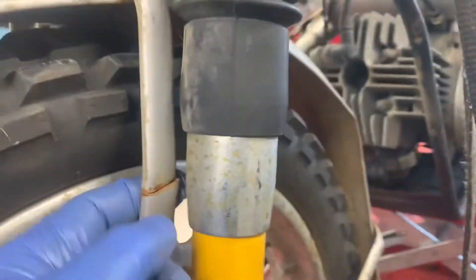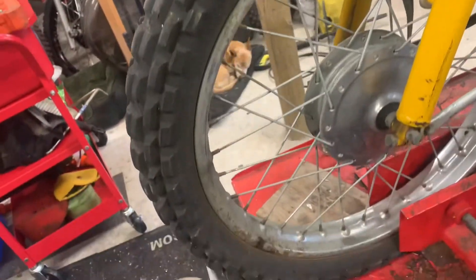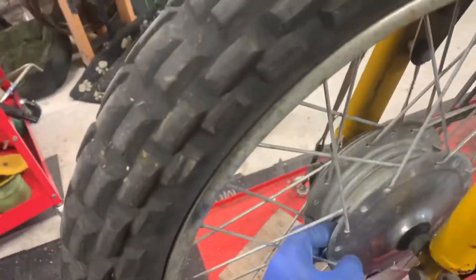If we have a good look around it — the front mudguard is cracked, there's a bracket someone can weld back together, or you could find a replacement. It's cracked both sides here and both sides here as well. Looks like someone may have repaired that at some point with a plate on that side. The rims are going to need re-chroming.